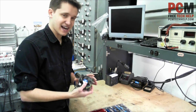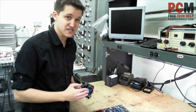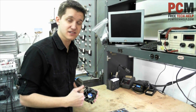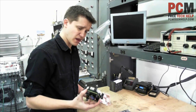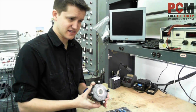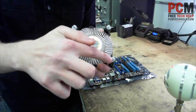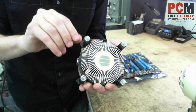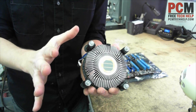This is the stock fan that comes with an Intel processor — this is an Intel Core i5 series processor. I believe all the Core i-series processors have the same build for the fan, so they should all install the same way. When you pull out the fan you have your actual pins. These are push-through pins. You push them in to lock them after you've slid it onto the board, and then you turn them and they lock in place and you're good to go.